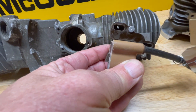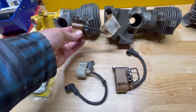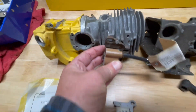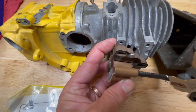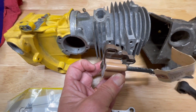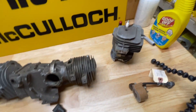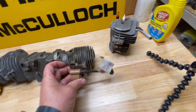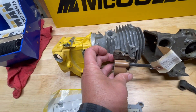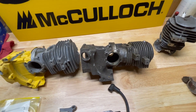But you can see those bolt holes line up and you can bolt that coil right on. You can get an adapter — I don't know why you would — but they make an adapter that fits in this space and lets you use a points-style coil on an electronic ignition cylinder. But anyway, this coil can bolt to either cylinder, electronic ignition or points and condenser.